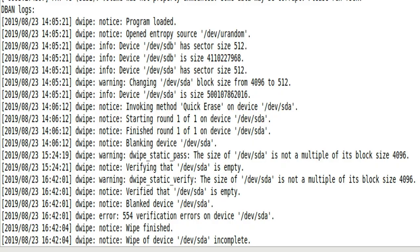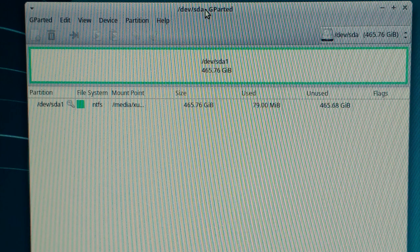It should be okay. Booting into the Linux DVD and using GParted, I created a new partition table because without it, an operating system might not see the disk. I chose NTFS for spare drives because both Windows and Linux can read it.